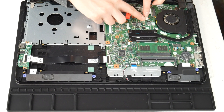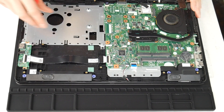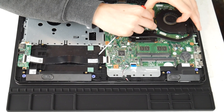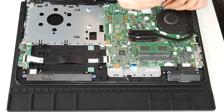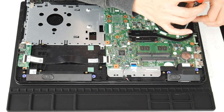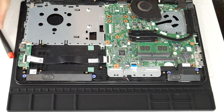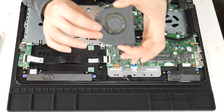Next, I'm going to show you how to clean your fan. This is another big reason why people have issues with their computer overheating. I'm going to unplug it and then take the two screws and undo it. I've examined my whole board and cleaned any spills or liquid off of it. Now I'm taking the fan off. I'm going to take a high-pressure air cannon — you could also use a hair dryer or a can of compressed air. I've included the can of compressed air and the air cannon down below.